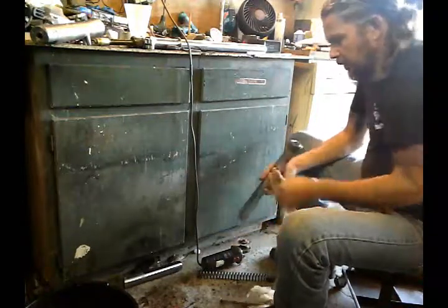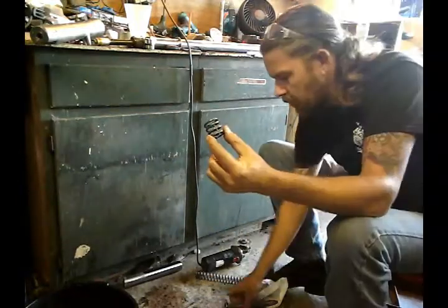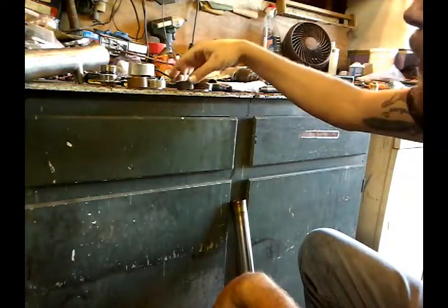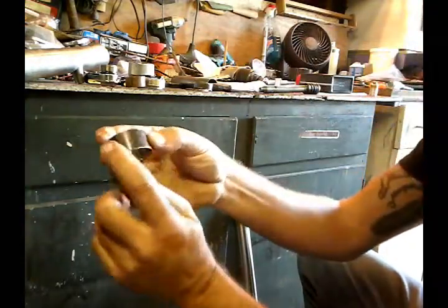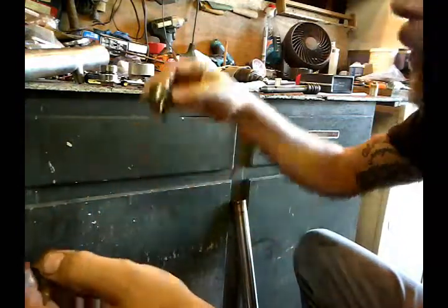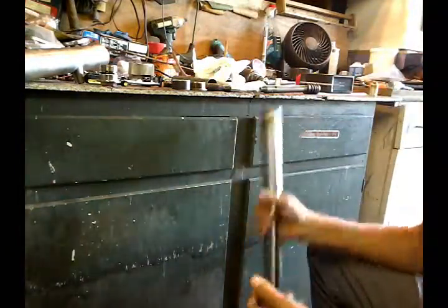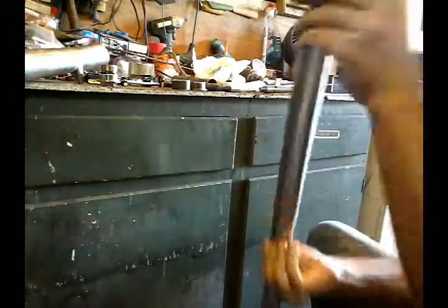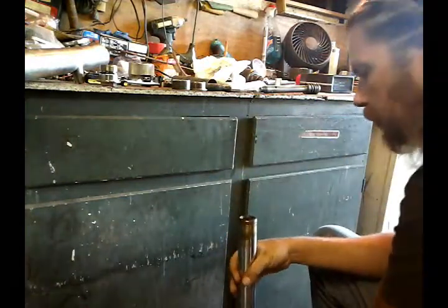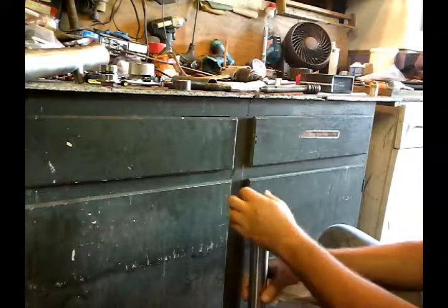Here we've got the damper. It goes this way. I took my bushings from the original fork. There's Teflon right here on these bushings, and as you can see the difference, the Teflon is all gone. This one is still in good shape. So these three, I'm not going to use. I'm going to use these. I'm going to put my fork seal on this side, which is the top side. Carefully slide it on. That's going to hold my other stuff from falling out of the way. Put my washer.